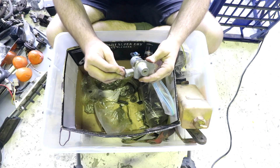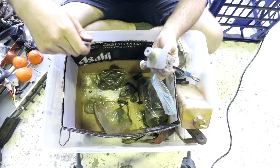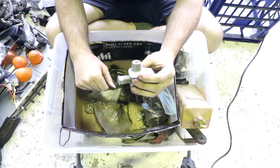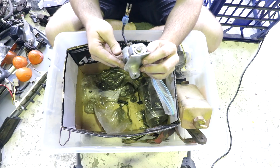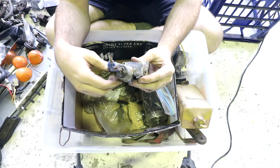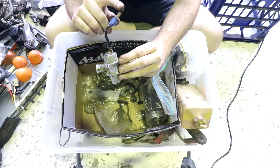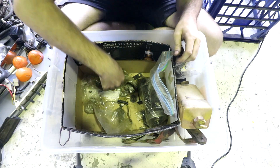This looks like the steering lock. So it's cool — this car has the ignition on the dash, and then the steering lock is a separate key. On your car you undo the steering lock and start the car with the same keyhole. On this one the steering lock is a separate thing you put on and off. Maybe I'm full of crap, because it has pins on the back — like it does something electric as well. It probably doesn't let you start it with the lock engaged, because the ignition in the dash is in a different spot. I'm guessing that's to stop you starting the car and driving away with your steering locked. I bet someone will comment and say that steering lock is not even from an S600.